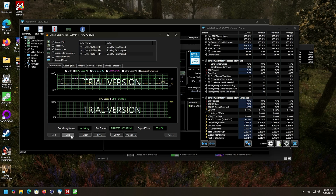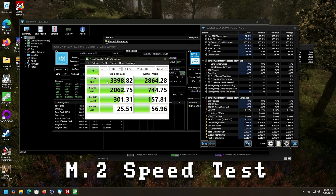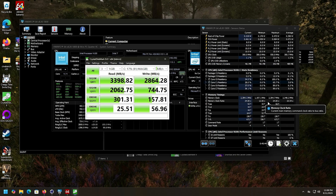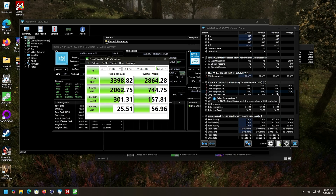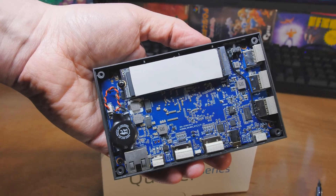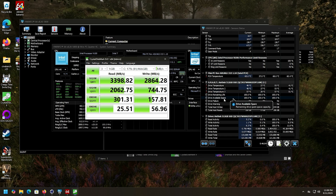The outer case gets a little warm but you can still pick it up fine. Looking at the 512 GB M.2 — read speed is 3398 MB/s and write is 2864 MB/s. IOPS: 73,000 read and 38,000 write. These are average PCIe Gen 3 speeds; the write is a little low but fine for a small PC. You can swap it out for something faster if needed. SSD temperatures peaked at 57°C, kept cool by the metal and thermal pad connected to the case heat sink.